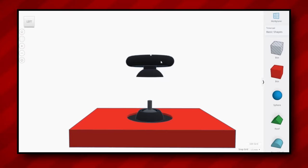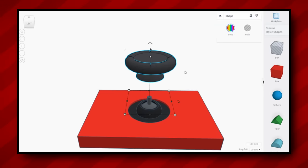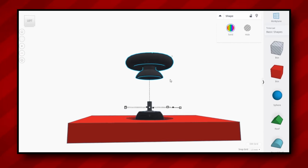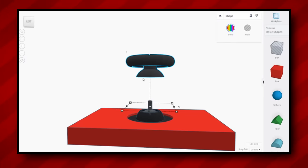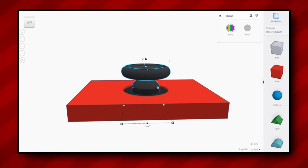Now, if we look again at the thumb cap part here, the top part, of course, is a hard plastic that you actually touch when you're using the joystick, but this little half-circle dome thing here on the bottom, that's actually a thin piece of soft rubber. It is not made of the same hard plastic as the rest of the controller. So then what we can do is, without taking apart the controller at all, we can kind of get in between and lift up that layer of rubber to clean out the internal parts.